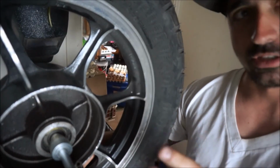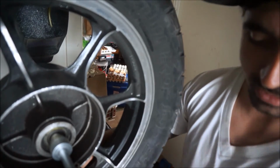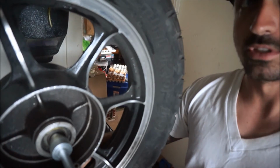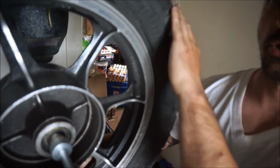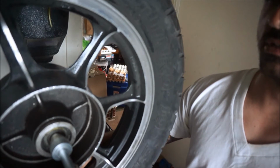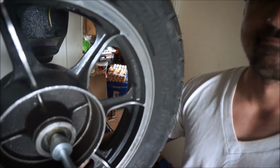That should hopefully balance it a little bit to the point where I can use maybe 1 or 2 or 3 of these little wheel weights, which is normal. I shouldn't have to use that much weight to balance a motorcycle tire. At least get me in the ballpark. So this rear wheel is not making it very easy for me, man. Oh well, more time, right?